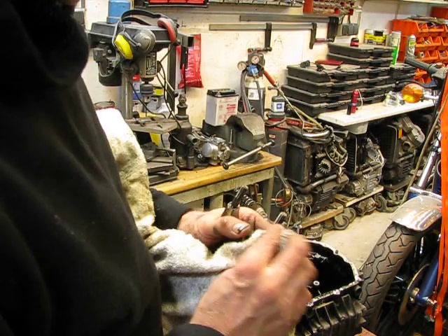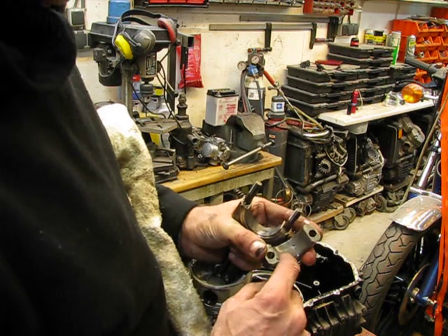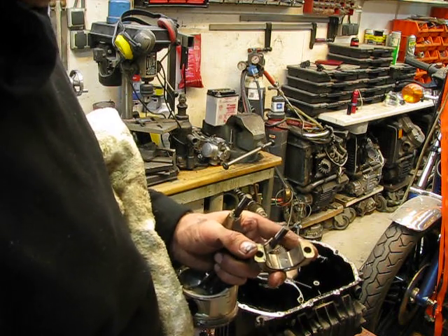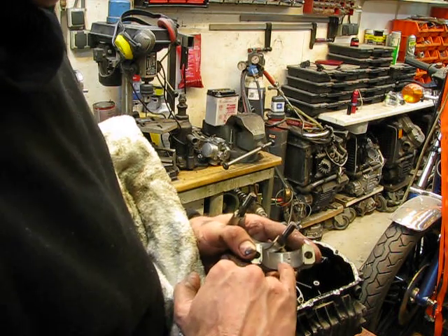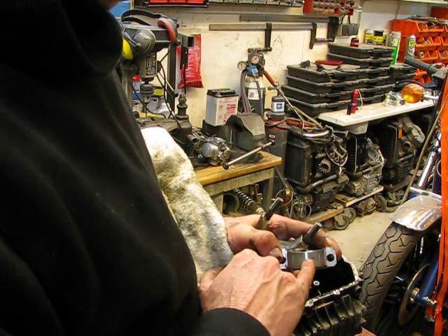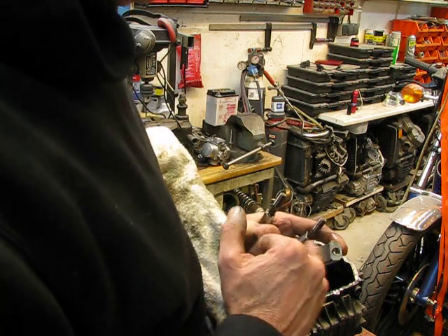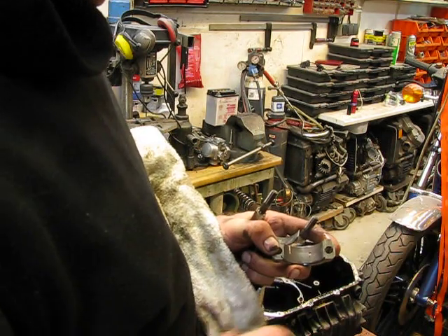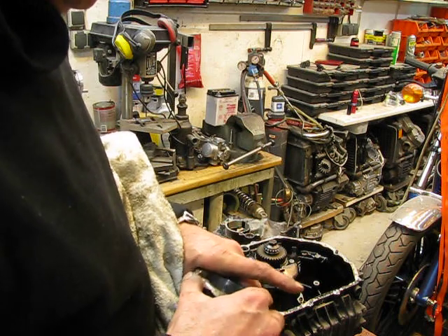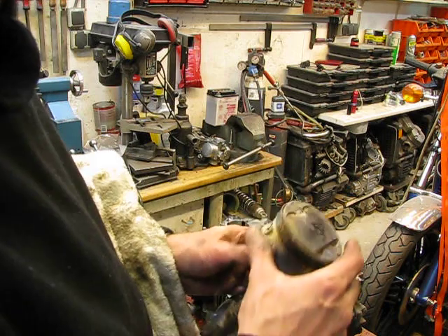The other side — maybe you can see something there. That's the gray material I like to see. That's also worn out, but this one — okay, not a big problem. You can see lines. That's dirt from the factory. When you start up your engine, dirt will grind a strip or a line inside your bearing. Yes, more cars have that, more engines have that, because the assembly was not working very clean.